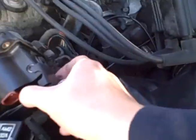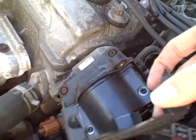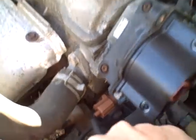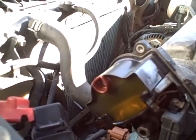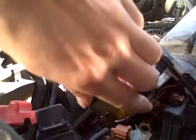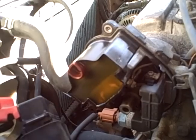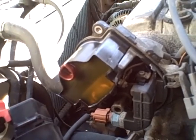We're going to pull them forward. Okay, so I'll set that somewhere and take a look here. I guess I didn't really need to take the cover off now I'm looking at it. Anyway, here's our positive and negative. This one's positive — there's a little plus sign right here that you can barely see. I'll check that, and then this is our output. So I'm going to check the resistance on these: positive to negative, and then positive to output. Let me go get my multimeter.